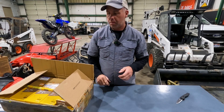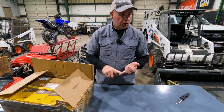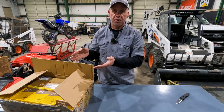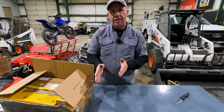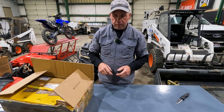We've got a couple of different options from Friday Parts, and that's what I like about it — they give you options on these kits. The pistons: what we're going to have to do is sleeve one cylinder. I bought an individual sleeve, because I had to buy oversized pistons for the other three bores. We're going to go 20 over — 0.5mm — and we're going to bore the block to that size to fit these pistons.